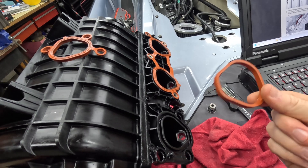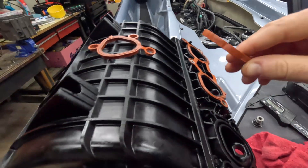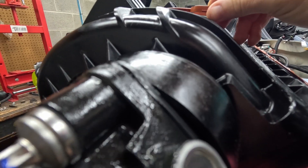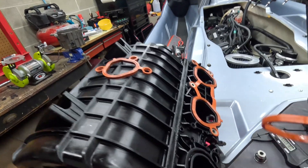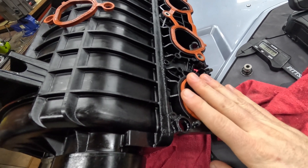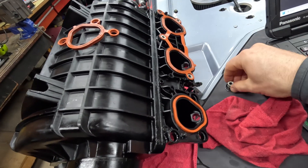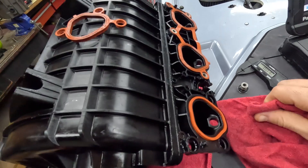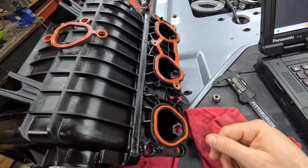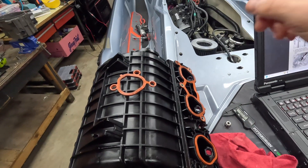I'm also going to experiment with using the older style 300-and-prior intake manifold gasket. You can see there is a slight thickness difference — the old style is just a tad thicker. I'll post the part number in the description if you want to try it. I've been running with just the shaved studs for a year with 40 hours and had no boost leaks up to 25 PSI, which is beyond what the supercharger pumps out anyway. So if you shave down your studs, you should be all set. Let's get this lined up to put it back into the ski.